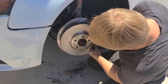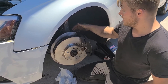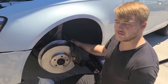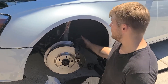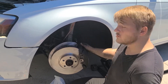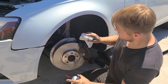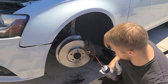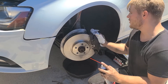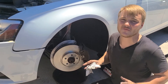Last step is to torque everything down. The big caliper housing bolts — the ones that go to the wheel bearing — are torqued to roughly 196 newton meters, which is about 150 foot-pounds. The small bolts in the back are torqued to 30 newton meters, about 25 to 30 foot-pounds. Make sure you torque those to spec and you'll be good to go. Spray some brake cleaner and wipe off all the grease and handprints. And that's how you change the brakes on a 2013 Audi A4 — step by step, simple and to the point. Be sure to follow, share, and subscribe — we've got more coming for you.